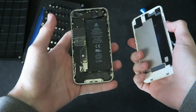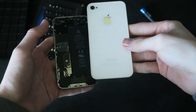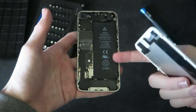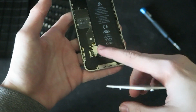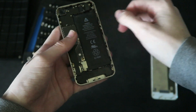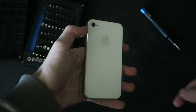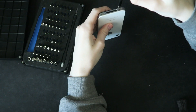We can easily replace it. So the iPhone 4 series, including the 4S, are actually pretty repairable. If you crack the back glass, no worries — just unscrew it, slide it off, and replace it with another one. Same with the battery. If you have a bad battery, swipe up the back glass, take it off, unscrew the battery connector, unplug it. Then there's a pull tab to help get off the battery. Yes, it's a mismatched iPhone 4 because the back glass did break — I bought it like this.